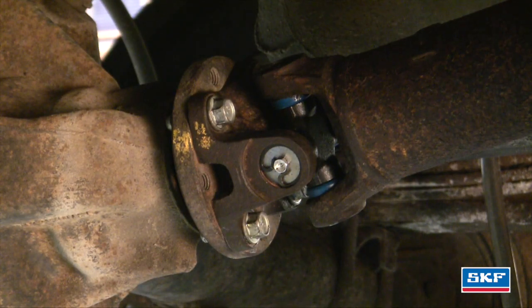This is one of our greasable Brute Force U-joints. The final step is to give it a little grease — you don't want to over-grease it, just a little bit more than what the factory has in there.